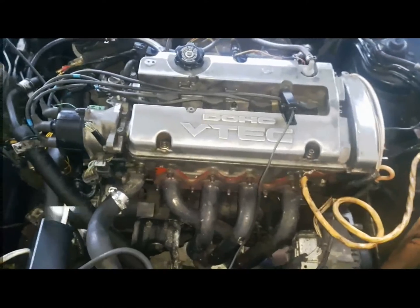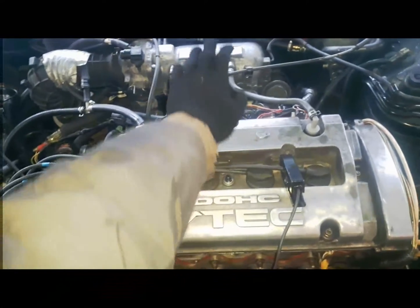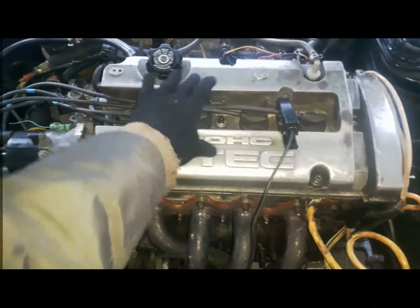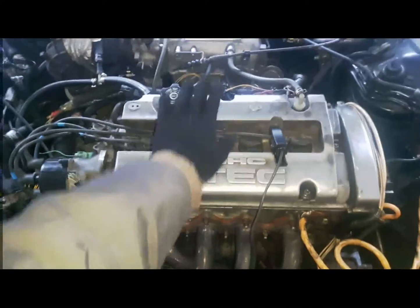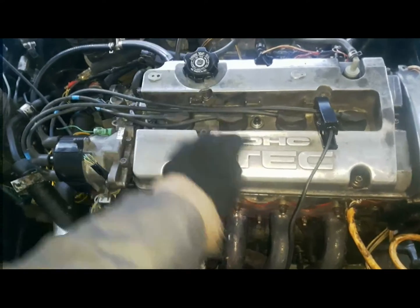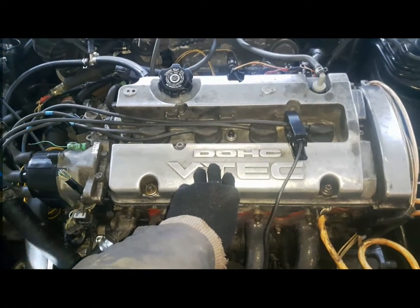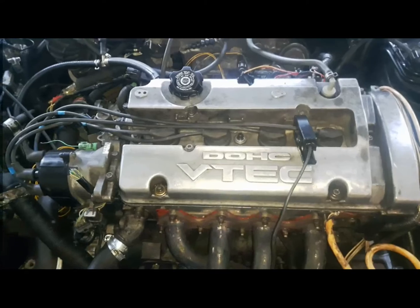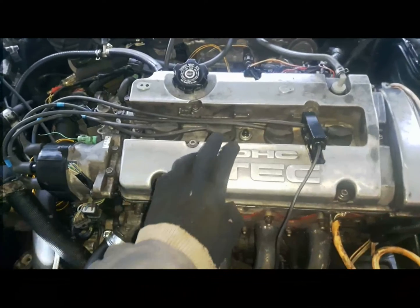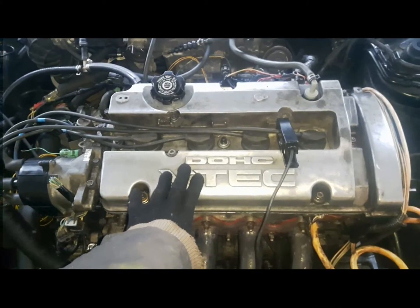I hope this helps. This is a four-cylinder, so the detonation knock sensor is at the back under the intake manifold. In the six-cylinder, usually it's under the intake manifold — the plenum has to come off, and sometimes the lower intake manifold has to come off, and then the detonation knock sensor is right there. Check the other video from White's Monkey on the Honda Pilot knock sensor — it will show the location of the detonation knock sensor on a 3.5 liter V6 engine.